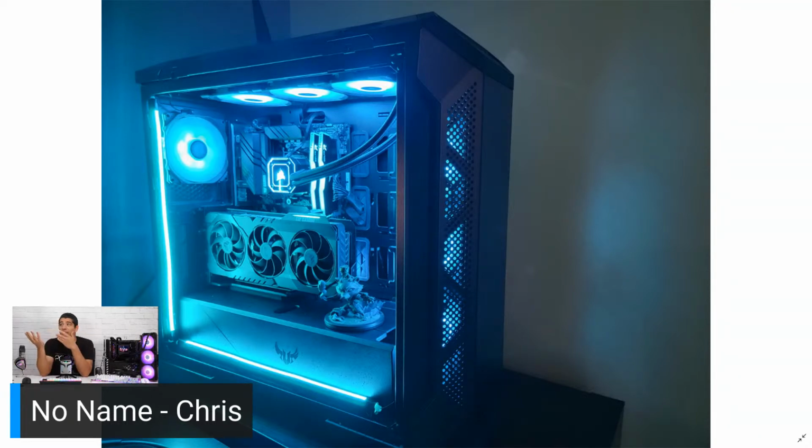To be honest, you've probably got way more AIO than you need. With the 3600, you could have just gone with a good quality tower heatsink or a 240. But 360 definitely is going to give you a huge amount of room to push the CPU as much as possible and keep it very cool. And of course, you can keep that even if you were to upgrade to a higher end Ryzen 5000 series part later in the future, right?